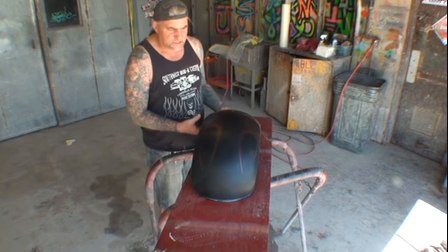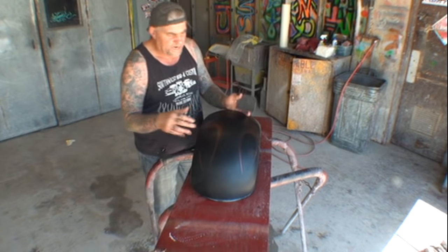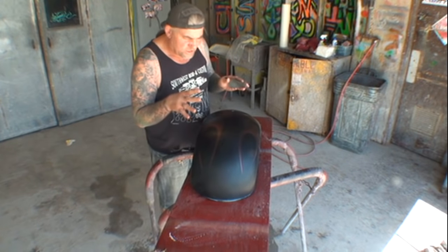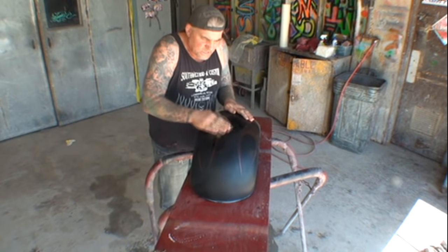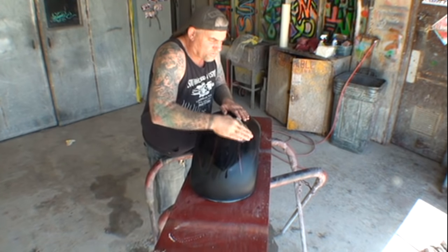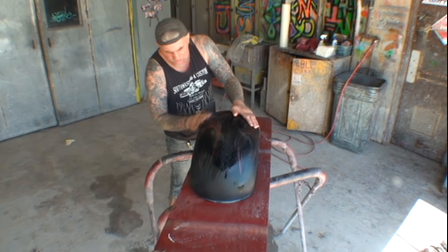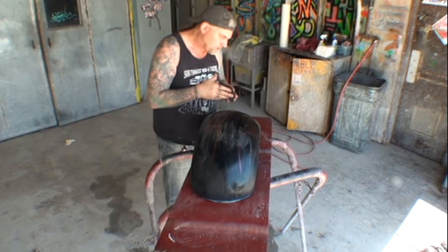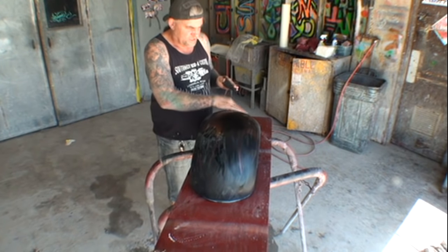So what we're going to do — since the gas tank is a small surface and we really can't see the flame job that we're laying on top — we're going to go ahead and use this fender because the fender is very big and large, and this is dry. The reason you want to dry it is because you might have missed some of the residue and I see some right here, so I'm just going to spot sand this to get that off. It's important to get that residue off of the tank or bike or car or whatever you're working on, because if you don't, it will or might show up when you clear coat it. It usually doesn't and it's nothing to fret over, but sometimes it might show up and that's what we don't want.